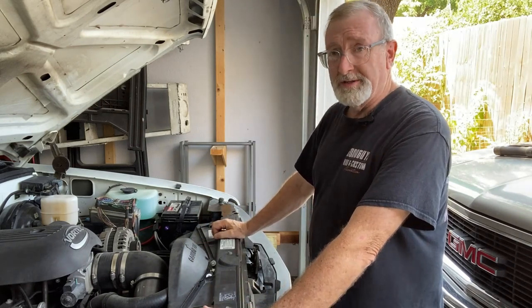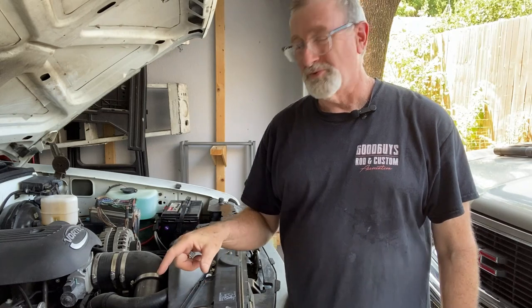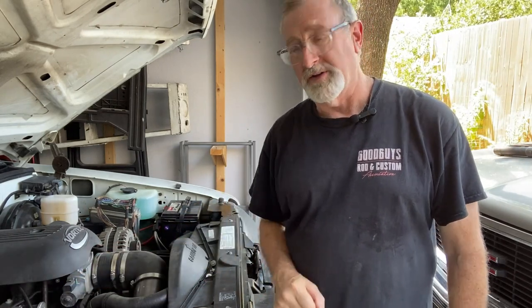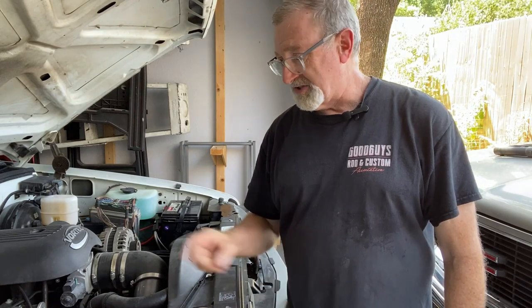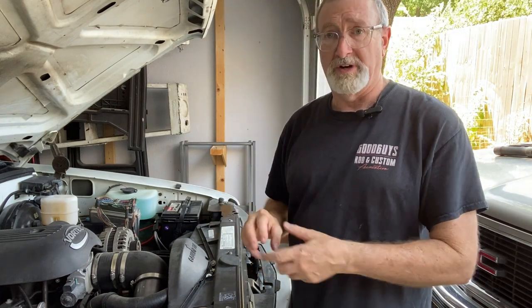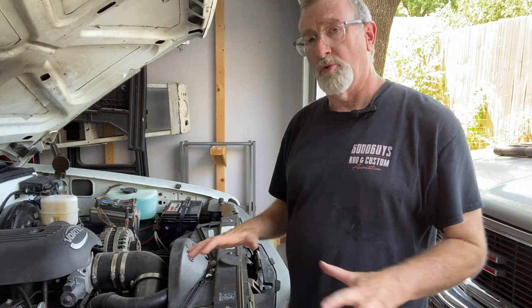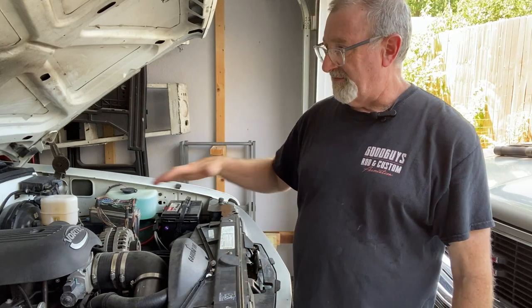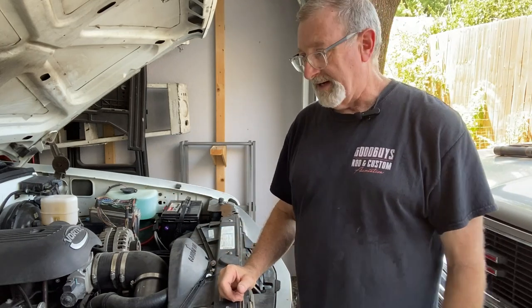Next we'll be tackling the AC. Now I just need to tidy up this fuse relay box over here that was for the fans — put it back together and mount it back on the fender well and secure that wire that I've just twisted on there. I need to solder that connection and we'll use some of that marine heat shrink on it as well. I use the marine heat shrink on all the wiring because it has adhesive on the inside, so it keeps any moisture out, because of the environment under the hood you don't want moisture getting in there to corrode a connection that could lead to a failure in the future.